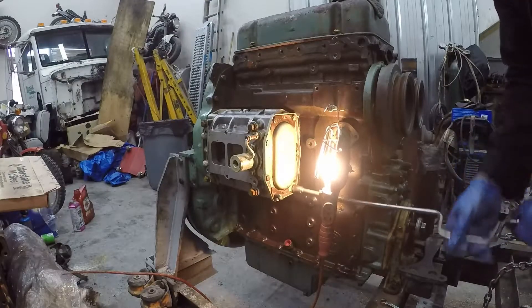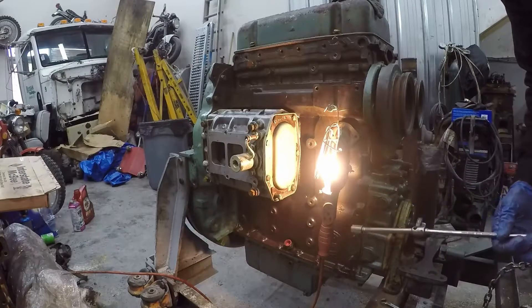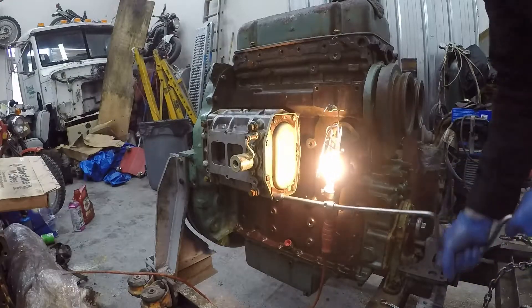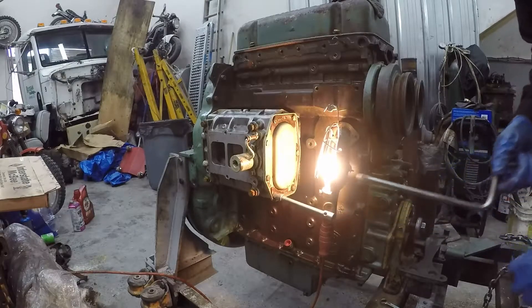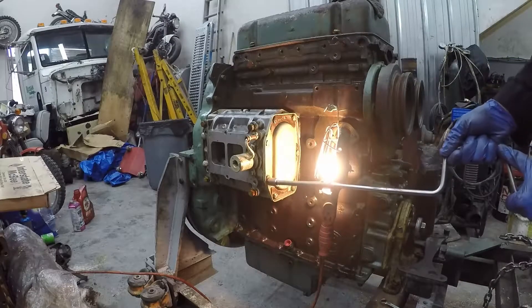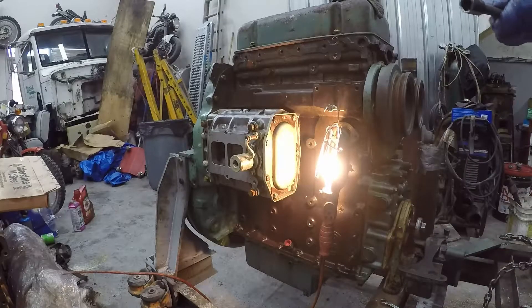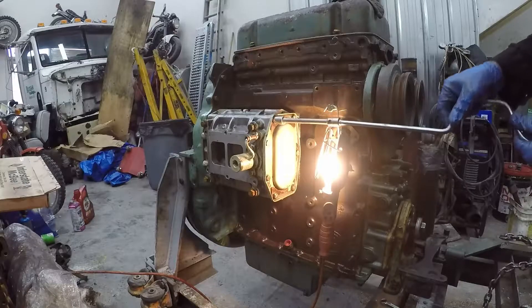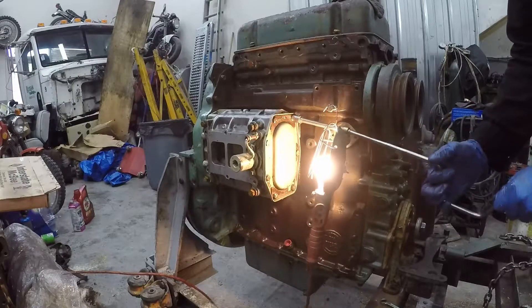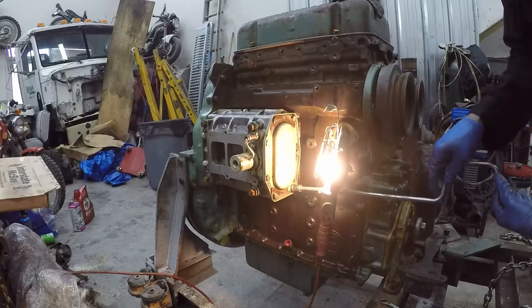This blower, being a silver blower, has that bypass, and that saves about seven horsepower on a 453. Maybe it saves five horsepower on something like this. On my 453T I made my own bypass — I used a natural blower and built my own bypass, and I have that one opening at 10 PSI, which works perfect.